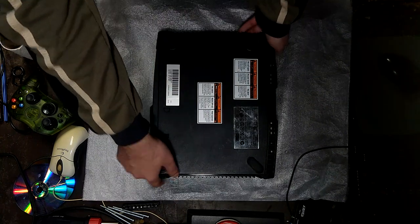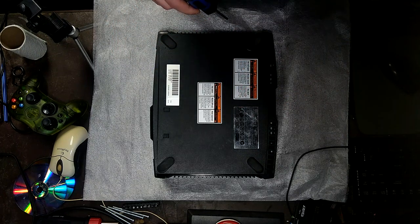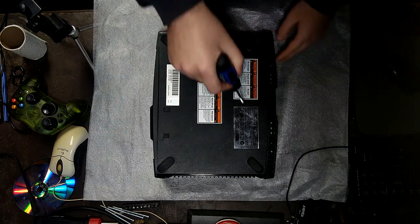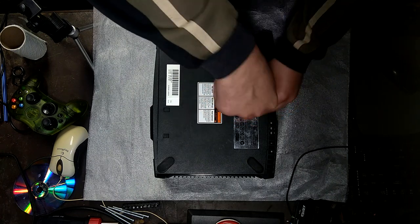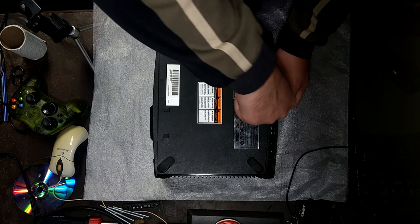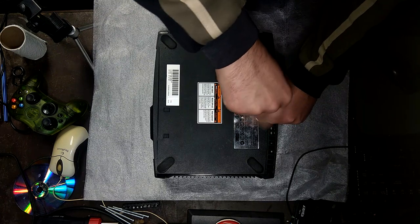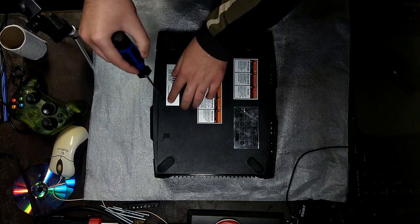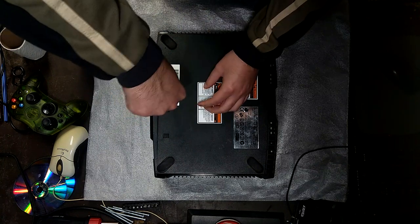I've never done one of these revisions before. You just have to solder a couple points together, and then it will unlock the enable write to the flash. Although for Sharp ones, I know you have to remove the wire later on once you've flashed it. At least it's advised to remove it. It probably sends voltage to an enable write pin. I guess you don't want anything bad happening with it. I don't know if it really is important, but I'll do it if it's necessary, but we don't know what it has inside yet, because we haven't been there yet.